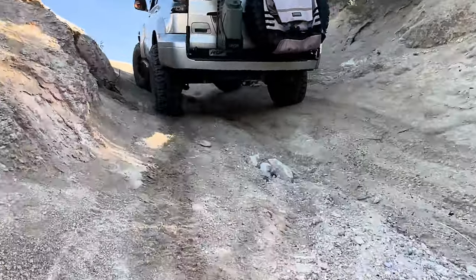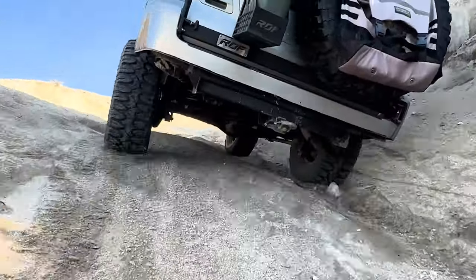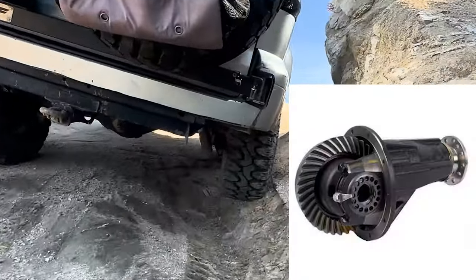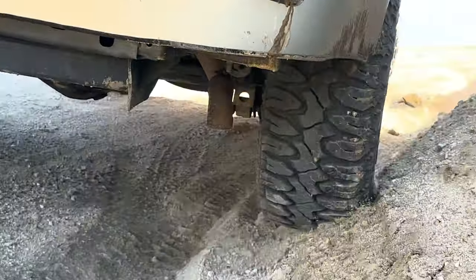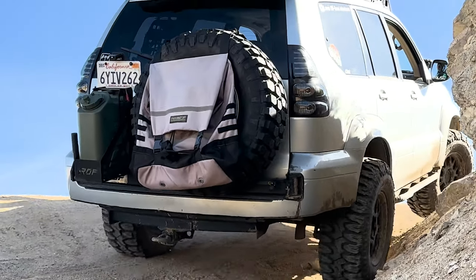If you're not upgrading your tire diameter more than a few percentage points larger than the stock 30.6 inches, you can pull the rear third member and send it to a differential shop for a pinion bearing and carrier bearing preload refresh, while continuing to utilize a stock gear ratio of 3.73 to 1.